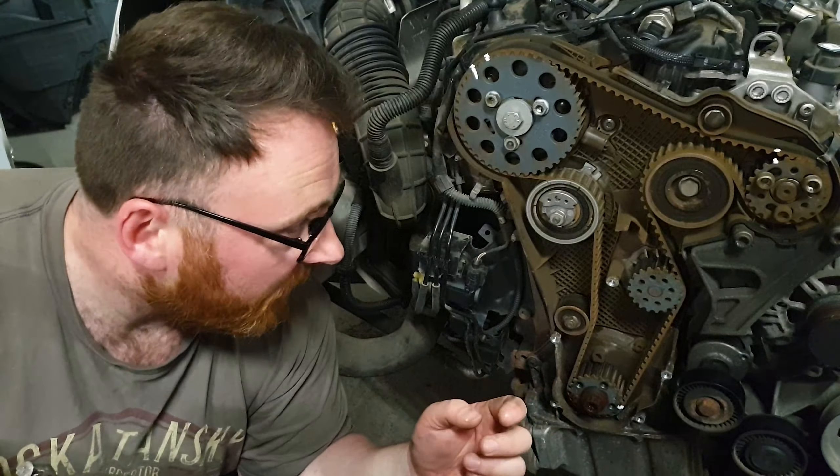As you remember, we did mark up our old belt. The reason I put one pulley with two marks is just so I've got a reference, so when I put this back on I'm not guessing which mark is for which pulley. I'll know that ties in exactly with the cam one and the rest fall off from there. When marking up, I always do this tooth by tooth — don't be tempted to just stretch the belt out. Be aware this belt will not form to the way the old one is, because it hasn't been run yet. Always count tooth by tooth, then double check. You can put this back on the engine, move a pulley out quite easily, and knock the whole timing out. So that's our new belt marked up — two dots for the cam, one dot for the fuel pump, and a final dot for the crank.